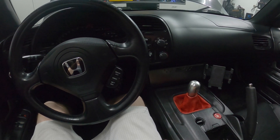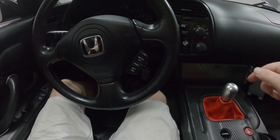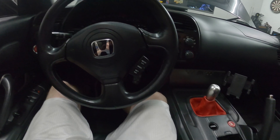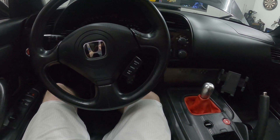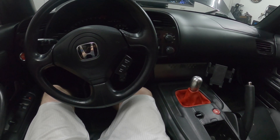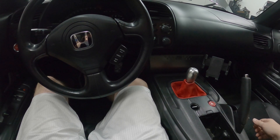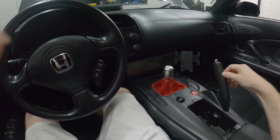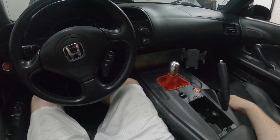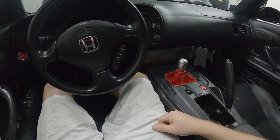This actually wasn't overly difficult — relatively straightforward. The hardest part was attaching the white wire to the light blue wire on the clutch interlock switch. Once I got the red quick-connect fitting it worked just fine. Had I known that ahead of time I probably could have knocked 25–30 minutes off the job. It was about 95 degrees in the garage today, so I took a break and changed, but it's all done.